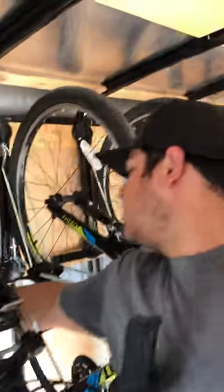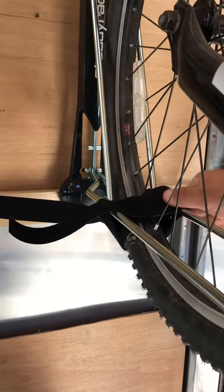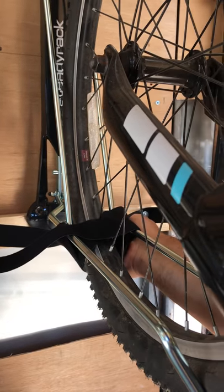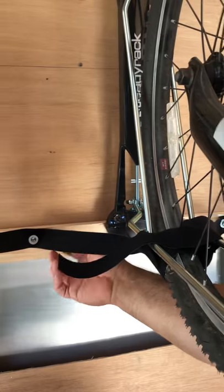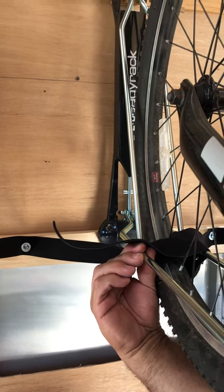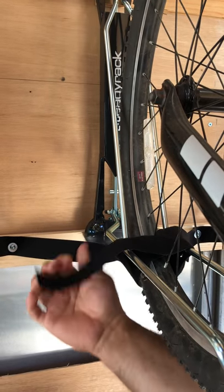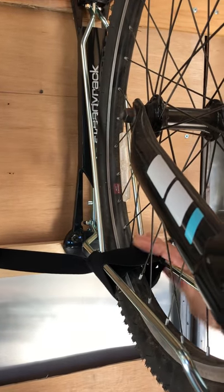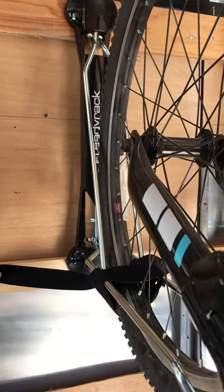Here's a perfect example of how they're secured down. I wrapped each velcro line around the steady rack first one time, then wrapped the whole tire, and the other side locked them securely. Then on this side I ran the loop through here, secured the steady rack first — because we don't want any slop — went around once, pulled it nice and snug to take all the play out, then wrapped it all the way across. Now I'm secured right and left side.